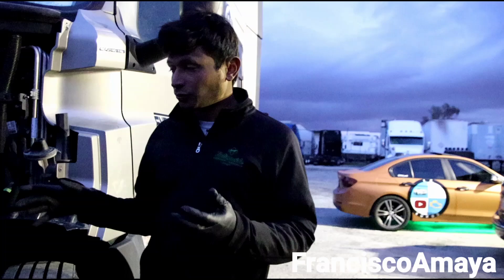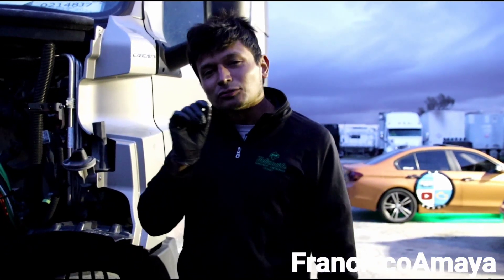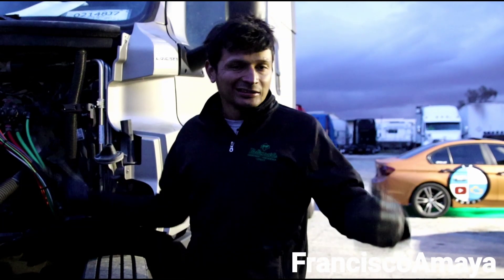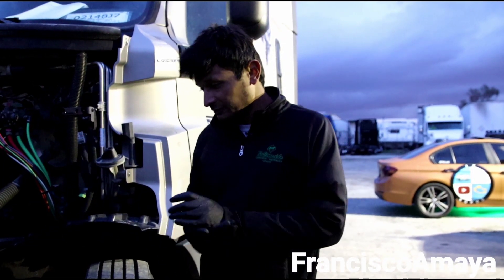That's the reason why I wanted to do this video — just to show you the major differences you are going to encounter, which are very little. It is good to know. If you have a question about how to do an oil change on this one, it's pretty simple. If you've done oil changes on the older Cascadias, this is the same thing. You have to bleed the air out with a primer pump and do the filter replacement the same way — no difference.